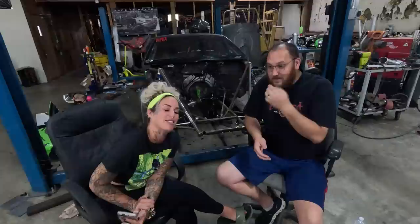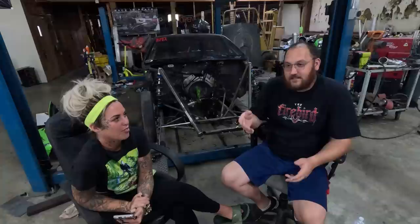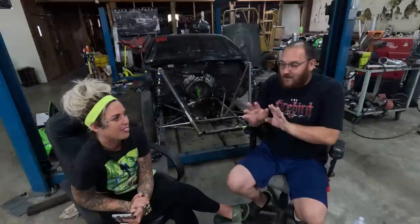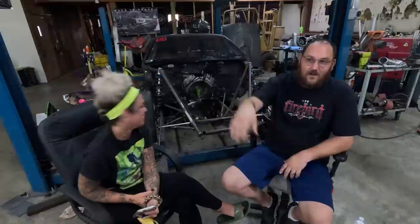The burnouts were hilarious — it lights off so quick because there's no lag. I was trying to start in first gear to be easy on the tire on a water-only track, manipulating the throttle to keep it as easy as possible, and that was not the way to do it. We kept getting tips and the best came from Murder Nova Sean Ellington — he said just put it in third gear and give it some throttle. So our next pass we went up, put it in third, gave it like 30-40% throttle, and the thing just burned out as long as you wanted. No drama, you could sit on a dry tire and do it no problem.